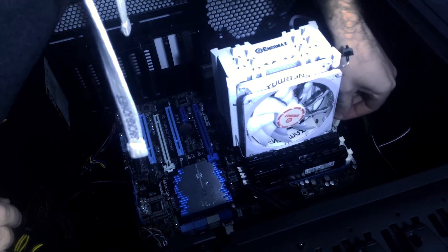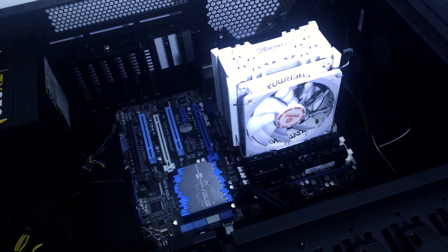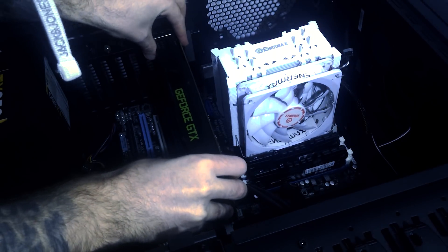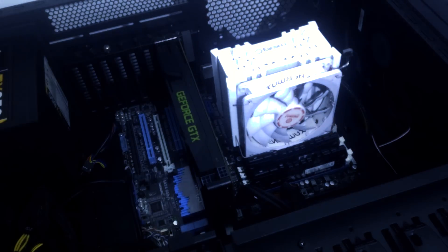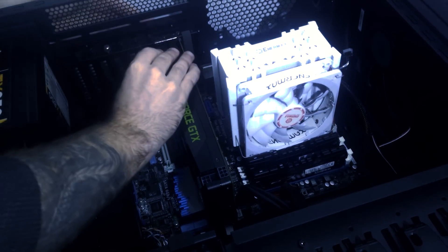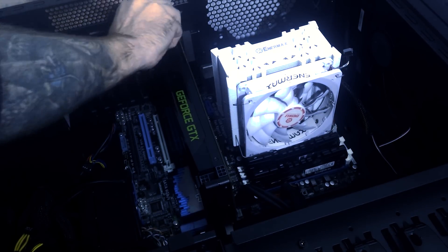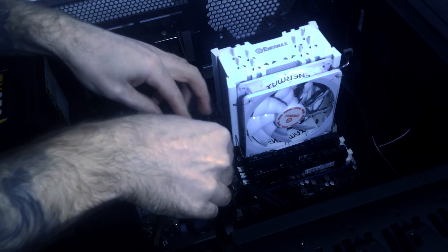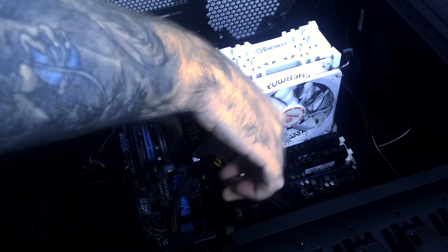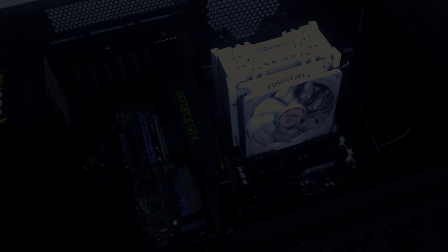Once everything is in place, I simply need to plug my CPU fan into the CPU fan header on my motherboard, then tidy the cable underneath the CPU cooler itself. Next I want to add my GPU — the best slot on this motherboard is the very top slot; push until you hear an audible click signifying it's correctly attached. Reattach all case screws to your GPU, attach the PCIe power, all power connectors for the motherboard, make sure the SSD is connected via SATA with power, and we are ready to power up.